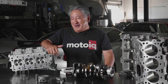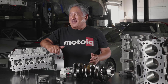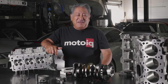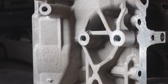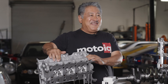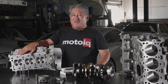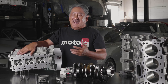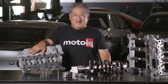Now we can talk about some popular options — if you want any of these, contact Raiden and they'll gladly add it to your quote. One cool option is vapor honing: a lot of these engines are oxidized, and vapor honing makes the surface look like a brand new casting. It's not sandblasting that leaves a porous finish — it actually leaves a kind of glossy, really clean, new casting look that doesn't leave fingerprints; basically makes it like new again in appearance. We also highly recommend cryogenic treating and WPC surface finishing, which add a lot to the durability of the engine and possibly a little performance — we really believe it helps durability quite a bit, as much as fifty percent.